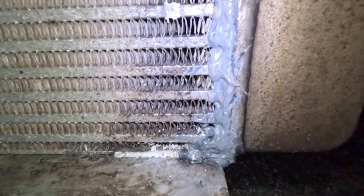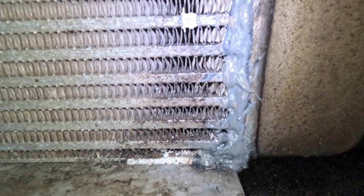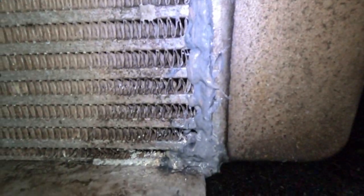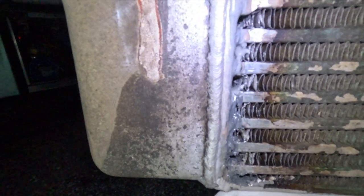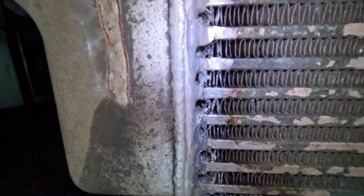Now it's under this epoxy. What he didn't do for me is fix the leak — to be honest, that's not his job. I was mainly hopeful to have him fix the structure. He tack-welded these little cracks anyway, but it's still leaking, which is a lot better than before — but still a little away from what I expected. So on top of the weld, I put on some JB Weld epoxy, and that held it up a lot better.